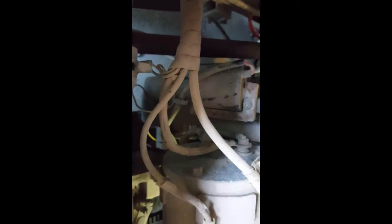So far all I've done is take three bolts out of the front of the motor, one on the side case. I went ahead and yanked the air box and disconnected the battery. Back here I took the hatch off the back and I got to get in there and get a couple bolts loose - there's one down in there that holds the side cover on the engine. It has to slide over to get all the bolts. I've never torn one of these apart before, but it's just a mower motor - Kawasaki.